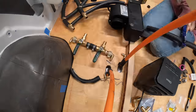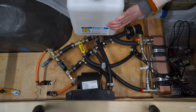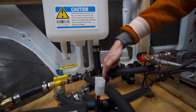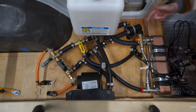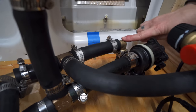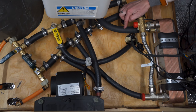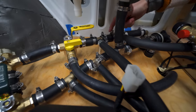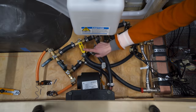Okay, so with a game plan in place, we got to work and after a few configurations, we ended up with this. Okay, so this is our expansion tank. We fill the glycol in here. The pump takes it down and pulls it in this direction, down under to the heater. It heats up in the heater and it comes back up through this line. And then it can flow into the heat exchanger and keep going towards the back, which leads it to the air matrix straight back.